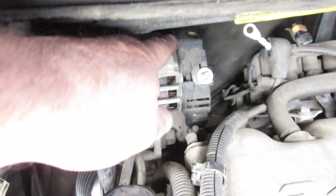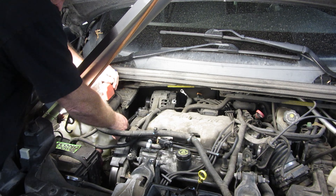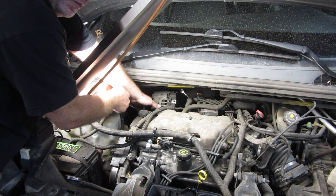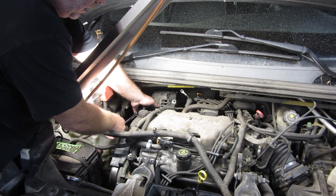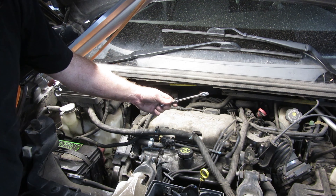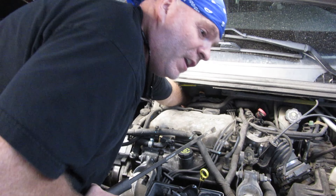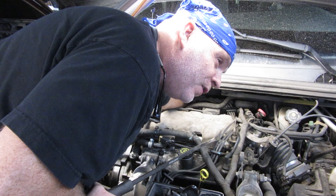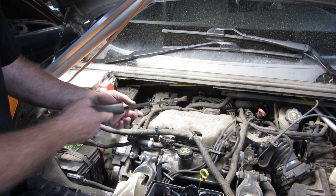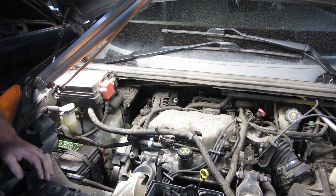This one right here is the one we're going to go after, and then if you reach back there's one on each side. This is 15 millimeter, and it appears all of them are 15 millimeter, but you're not going to be able to get them all with a socket because I could barely fit the socket on the one in the back. I got a 15 millimeter ratcheting wrench that I was able to get onto the back of that, reached back there, and then used my pry bar going as far back as I could. It finally popped loose — actually easier than I thought.